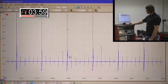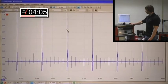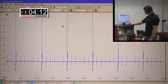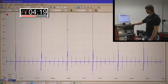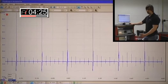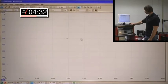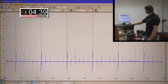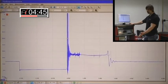I've got auto, which automatically puts the trigger on, but you don't always get the right image — it could trigger on noise at around 50% of the 100-volt range, so you don't really want to use that. There's also single event, which takes a snapshot of a single trigger, but that's no good since we want to keep looking at it. Putting it on repeat at about 50 volts, I now have a stable image of various events. I just reduce the time base to one millisecond and I've got my event on that particular coil.